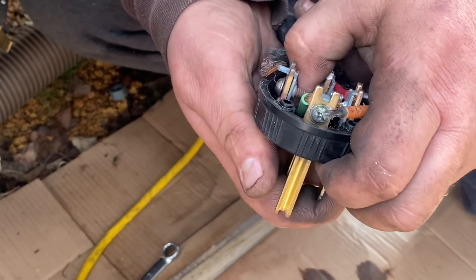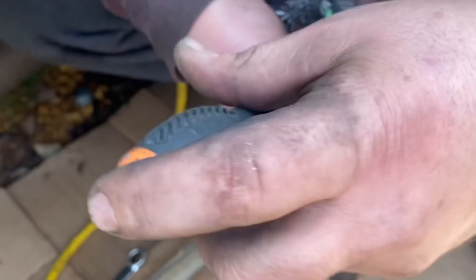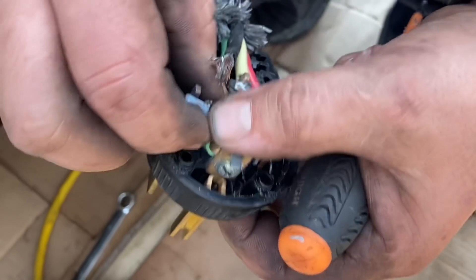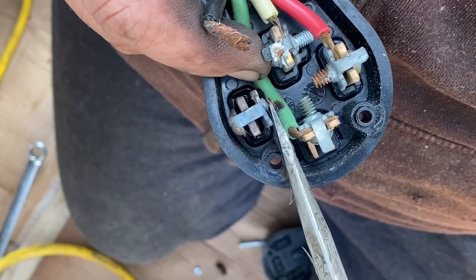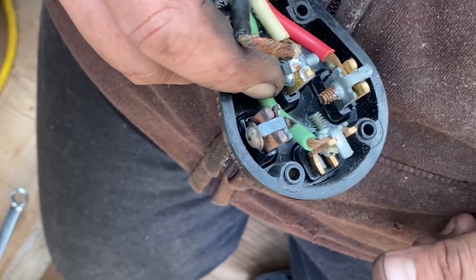Make sure that's not rubbing through - that should be able to solve it. The ground wire has been getting hot from that screw coming through, so I'm going to take this off and move it down lower so it can't come anywhere near that.